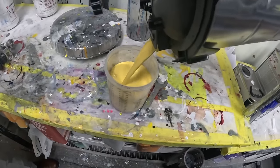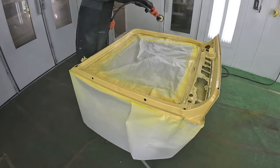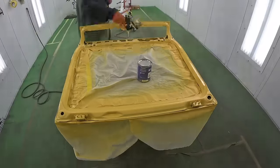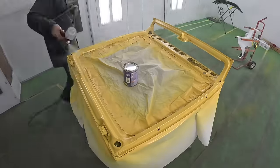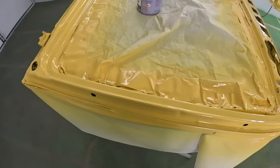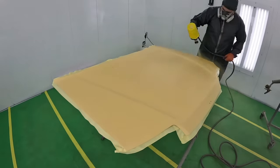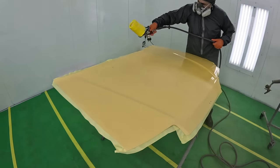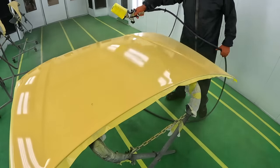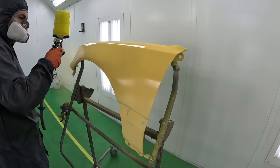This is a pro tip when it comes to spraying a full vehicle. Throughout the next few scenes, you're going to notice the same process for all of the parts. First, they're going to get another sealer. Remember we talked about that color build primer? Well, now we're going to use it and turn it into a color build sealer, and that just has to do with how it's mixed. So you'll get the color build sealer first, then the base coat, and then the clear coat. So enjoy these few clips of us getting this OEM Barbados yellow color sprayed back in.